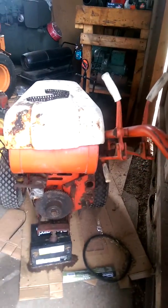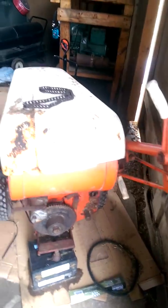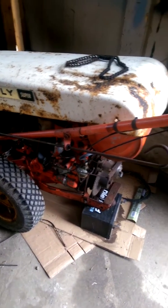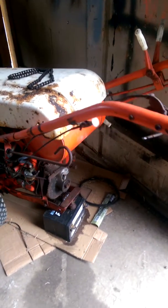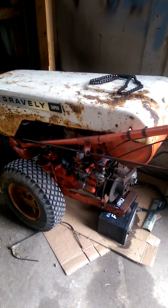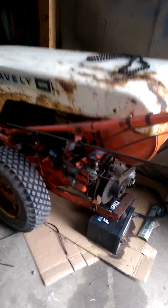Here's an L8. It's got the little knob down there for the high-low. I had to take the carburetor off this one, which I got for $75. The carburetor is completely locked up on it, but it surprisingly looks to have a good governor and other good parts. The clutch, the starter clutch is good. I think once I fix that buggered carburetor it'll be good on this one.